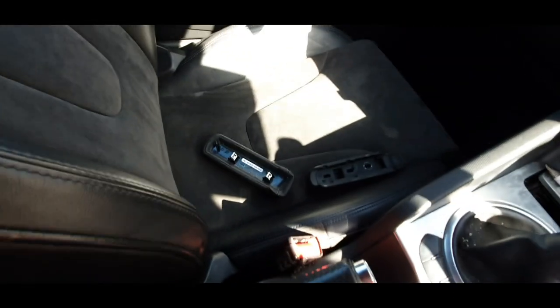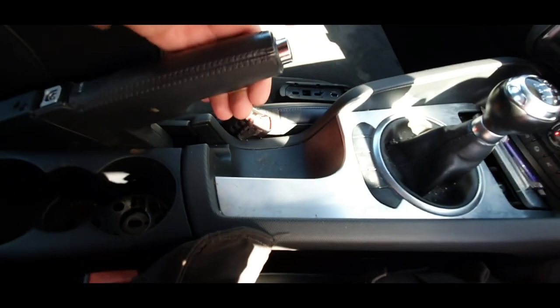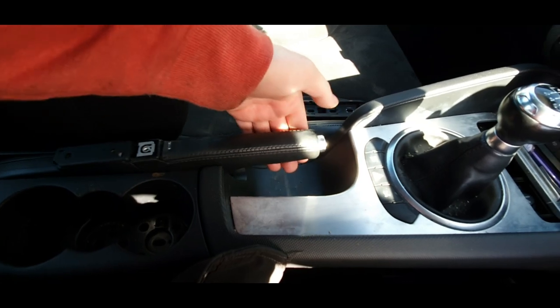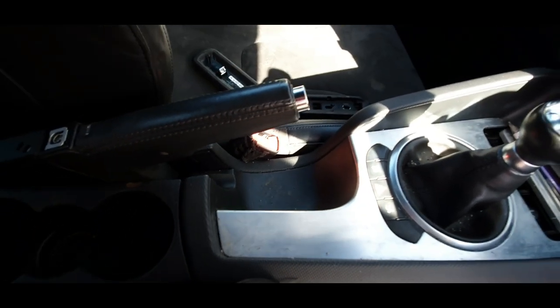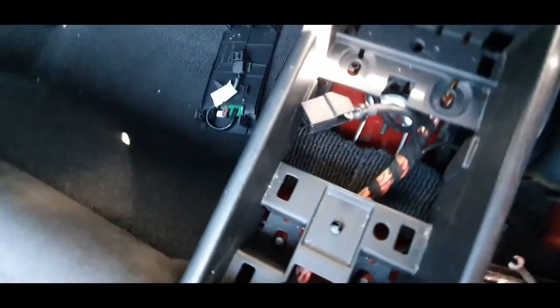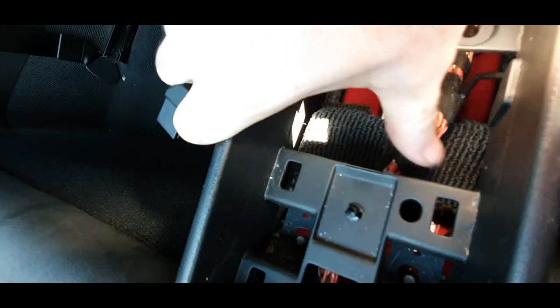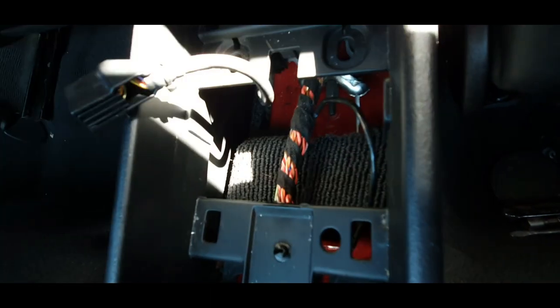Let's get all the bits back on and adjust a little bit more to stop it coming up so much. I would say unless that's a trait of an Audi, no more than three or four clicks. That's way more than I'd like it to be. Looking in the back — that cable — yeah, it's definitely stretched on that one side. It's definitely a little bit longer on that side. It's not sticking, so that'll do me.